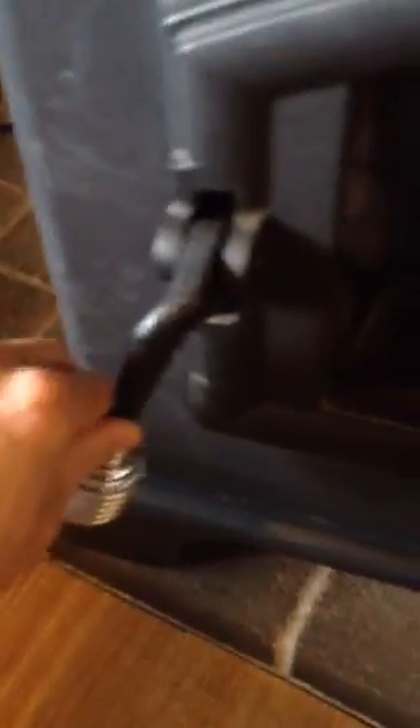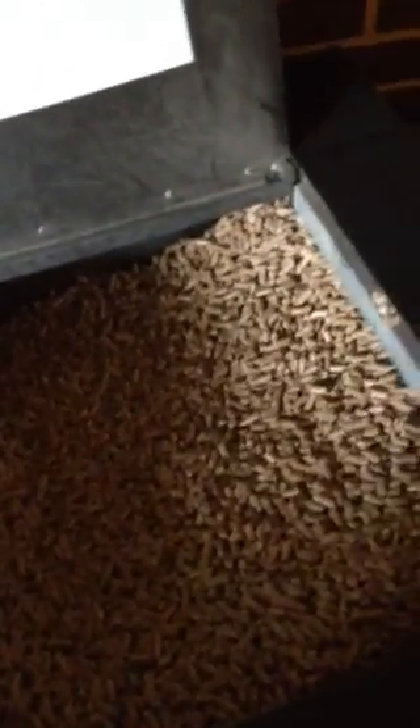Also want to make sure the door is closed. Usually these stoves, if this lid is open, the pellet feeder will stop so you can't get your fingers taken off. But that became an issue because I wanted to put more pellets than it held, so they would stack over the top a little bit — so this safety switch is just glued down. But as you can see, it still closes and it doesn't affect anything.